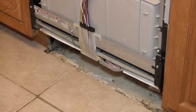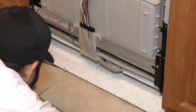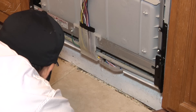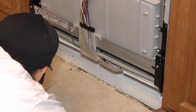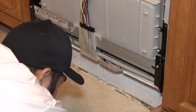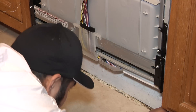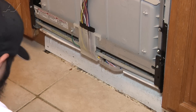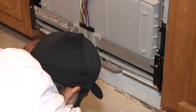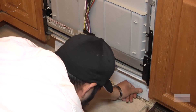The next step of the repair is to install the kick plate at the bottom. To do so, we're going to line up both panels and slide them under the dishwasher. I'm going to get my screw ready on my drill — again, this is the white quarter-inch screw. I'll line my toe plate in place and re-secure the panels with the screw.